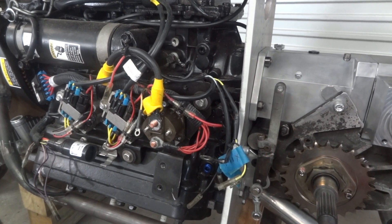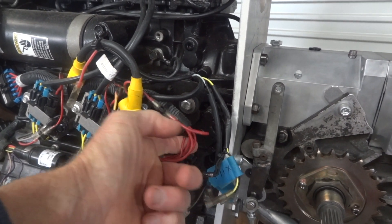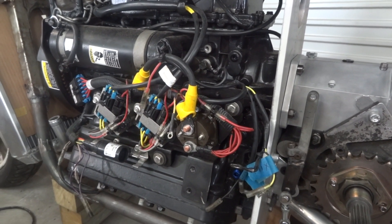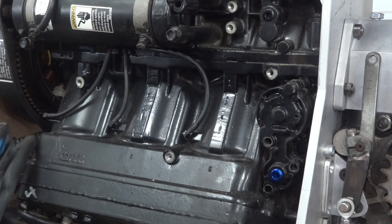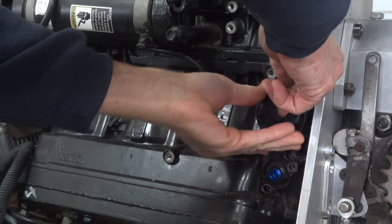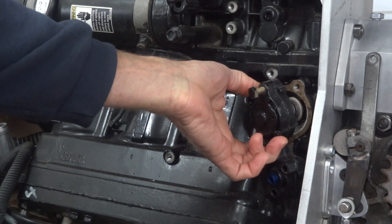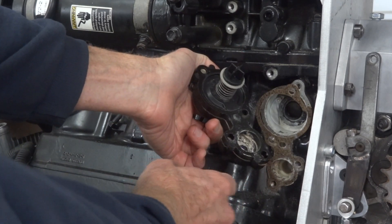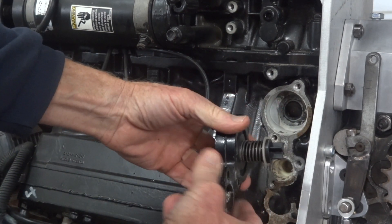To get the water into the engine, we're going to come in through the poppet valve which is under there, which requires taking all this gubbins off — which has to come off sooner or later, so I'll take it off now. Our little engine looks a lot nicer without all that wiring hanging off it. In here we've got our little poppet valve for letting water out of the engine when it's an outboard motor and gets enough pressure up, controlled by a little servo with some sort of porting. But we're going to take that out because we want to let the water in here rather than out.